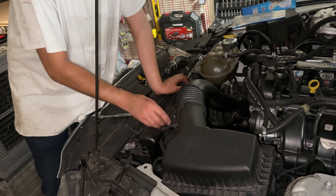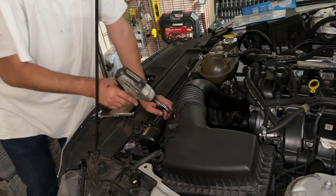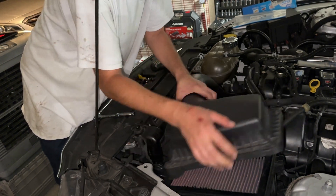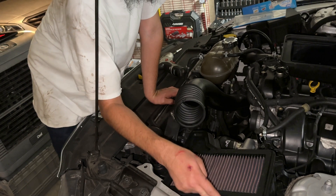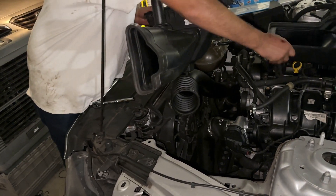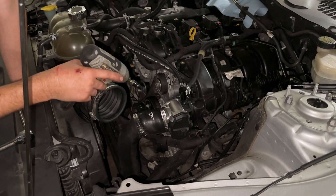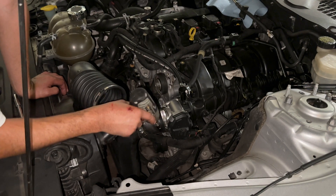For starters, there's a connector here on the side that we have to take off — go ahead and pull that off. Then you have a 7mm clamp directly from Ford; go ahead and take that off. Open one clip, open two, pull her back, pull it off — there's your first cap. Now most of you are going to have a 12mm or a 10mm bolt here. Take off the box and lift it out, then put your other half back on so the sensor stays clean. If you have aftermarket intake pipes, it's going to require an 8mm or standard 10mm depending on which hose clamps you have.